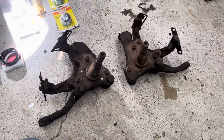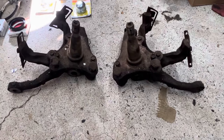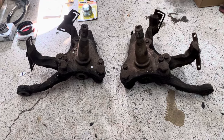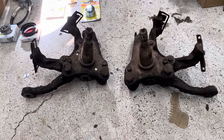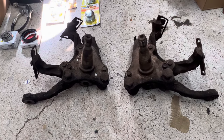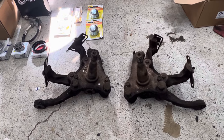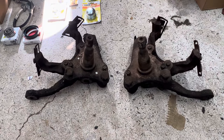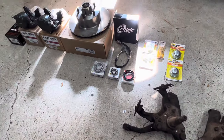Now, what cars can you find these out of? These are readily available for the most part in scrapyards. The earliest vehicles are the Aspen and Volare, which came out in 76 and run until about 78 or 79. Then we transition to the small Cordobas which come out in 1980, as well as the Dodge Mirada and the 80s square body cars, which are the St. Regis, New Yorker, Fifth Avenue, and Diplomats. If you happen to source these from a police package car, you might have the larger rotors which would disallow the 14 inch wheels and require a 15 inch. So pay mind to the size of the rotors, and I'll give an exact measurement as we approach the installation steps.